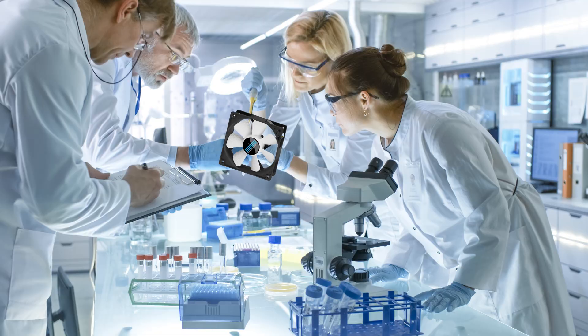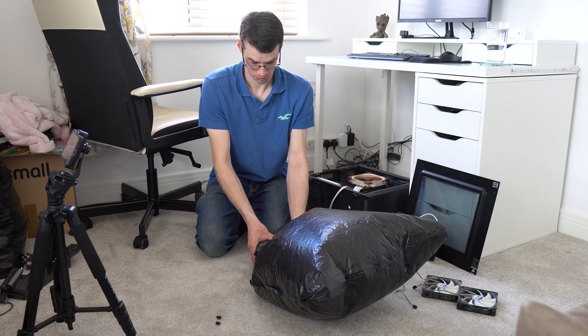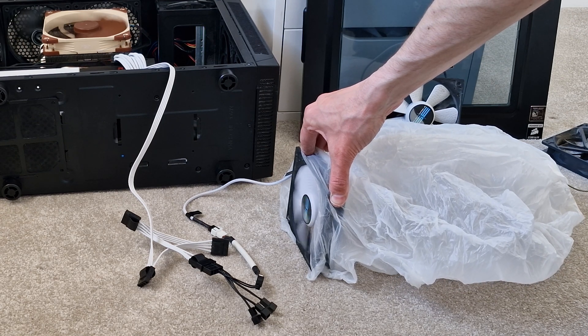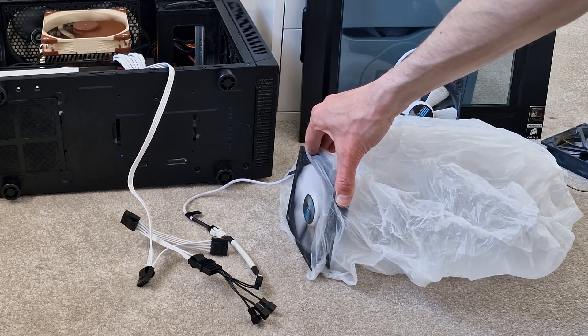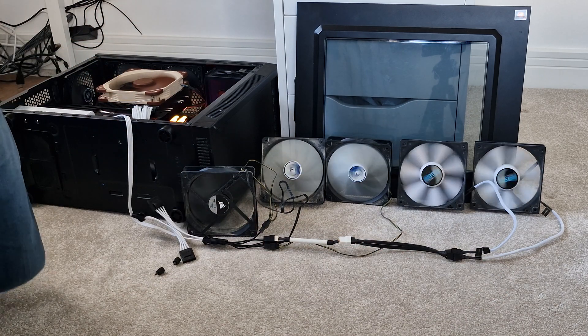I say they're working fine, but how do I actually know this? They don't work well anymore since I literally removed all their fins. But this was all part of some ultra-scientific testing to work out whether case fans in general can still work fine after a decade or more. The first idea I had was to attempt the bag test — where you wrap a plastic bag around your case fans and make sure it's directed inward. As long as there's a proper seal around all parts of the fan, in theory you can keep track of how long the bag takes to fill up, and use this to work out whether the fan is still in good working order. The problem is this is actually quite difficult to get a proper seal around the fan, especially when using zip-lock bags. You could tell though that the fans were in good enough condition just by looking at them — they were spinning fine and weren't making loads of weird noises.